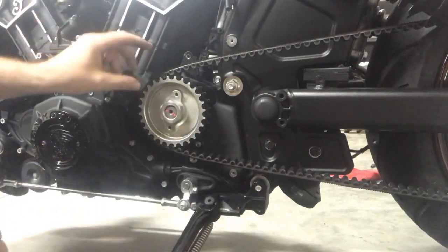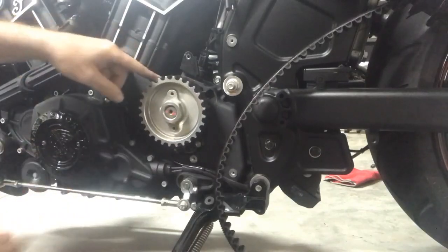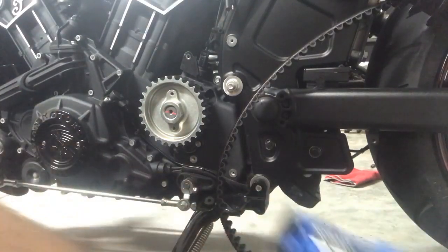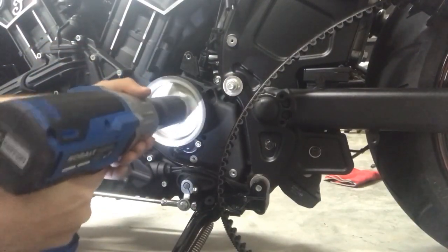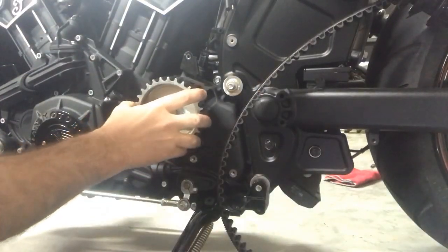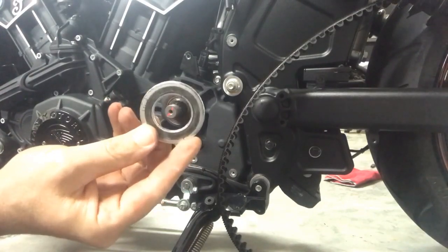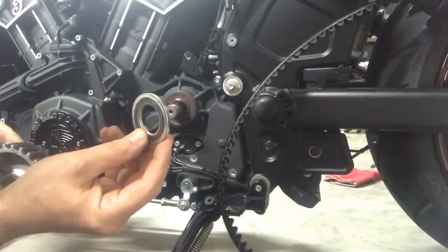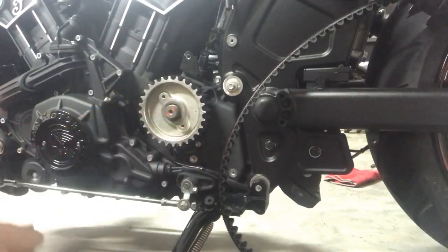Remove the spacer. I've already got enough slack in the belt so I'm gonna go ahead and pull the belt loose. Now we have to remove this — it's a 36 millimeter. If you try and use a breaker bar on it all you're gonna hear is a bunch of popping and grinding noises; you've got to get the big dog for this — it takes it right off. Remember, this is the large spacer that is required to go on there. Make sure that's on there because it pulls the whole pulley out further, which gives you clearance for the 240 rear tire.